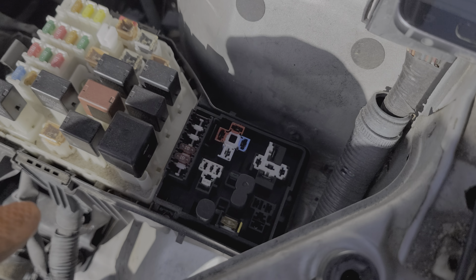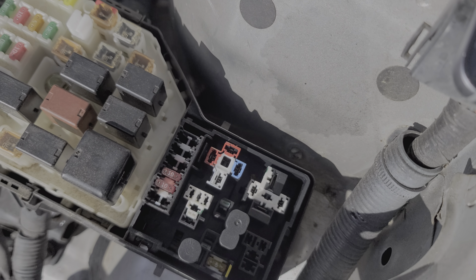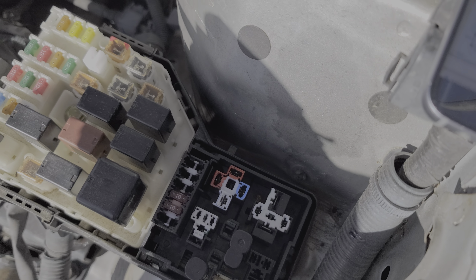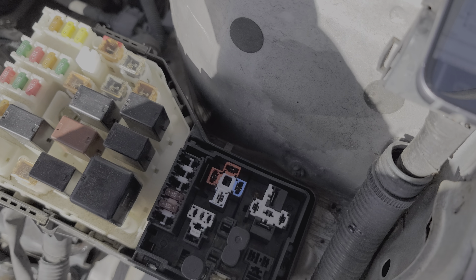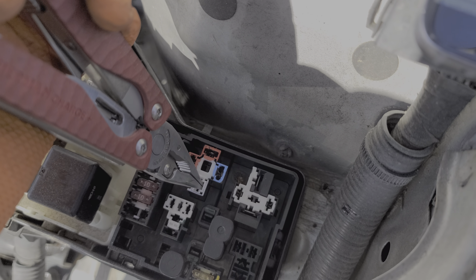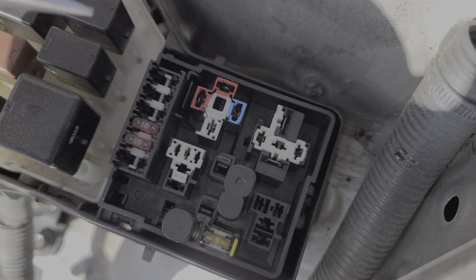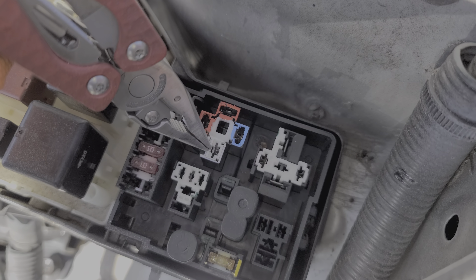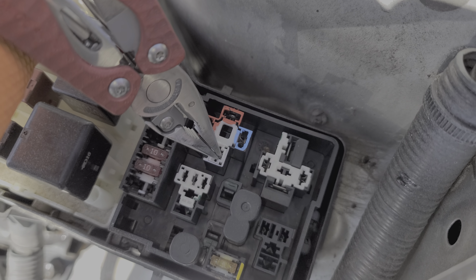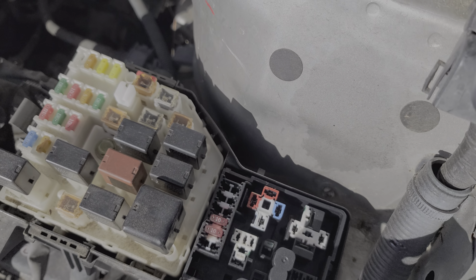When the ground comes in and the power is coming in, that's what triggers the relay — that's what makes it go off. When the relay is triggered, it takes power from this pin and sends it into this pin, and this pin goes directly to the starter. You can provide your own source of power into this pin to test whether the starter will turn over. Make sure that your car is in park or neutral if you do that.